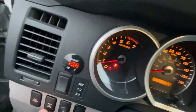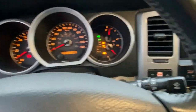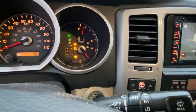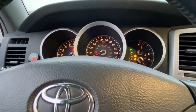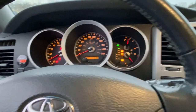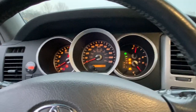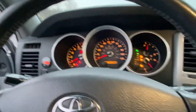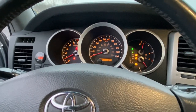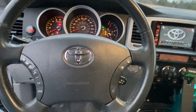The traction control mod works pretty well — it's not too different from turning on the transfer case center diff lock, but it's nice to have a little insurance. Flipping the switch turns off VSC, turns off traction control, and disables ABS as well. It's nice when you're off-road because the traction control definitely cuts power when rolling through certain terrain. Sometimes you think you can power through and Toyota thinks you need to crawl out at 1000 RPM, so this lets me override that.